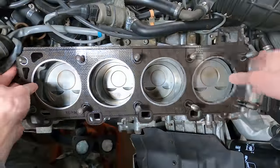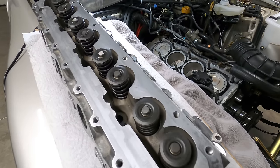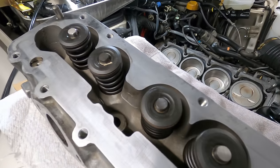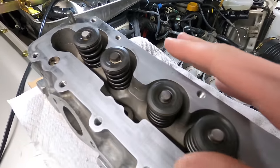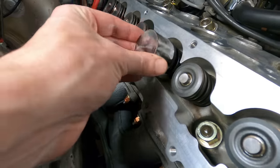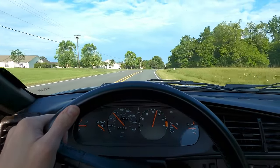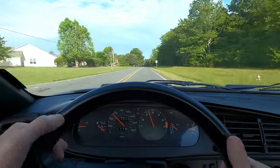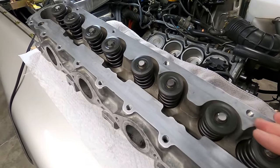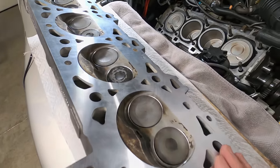Moving on to some less obvious mechanical modifications: when replacing the head gasket on the car, I had the cylinder head rebuilt with all new valve springs, guides, and seals, and here I opted to use a set of valve springs from the 944 Turbo. The turbo valve springs have a higher spring rate by about 25% over the naturally aspirated springs, which provides some valve float reduction benefits at higher RPM. While I don't spend a lot of time above 5,000 RPM when driving the car, the stiffer springs do improve top-end performance as the car approaches redline. This change was also budget-driven, as the turbo springs are more affordable at around $20 per pair versus about $50 per pair on the NA springs, equating to a $250 savings when rebuilding the head.